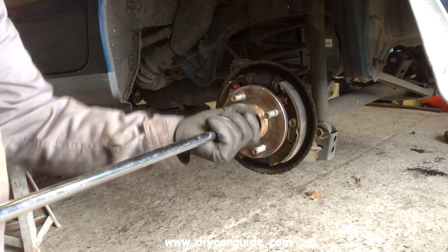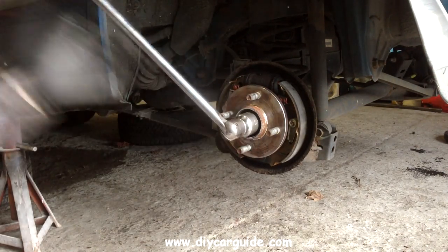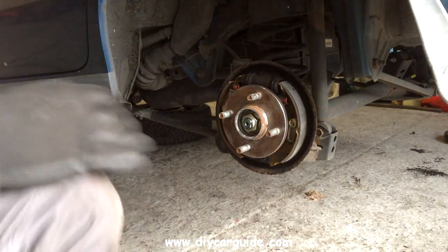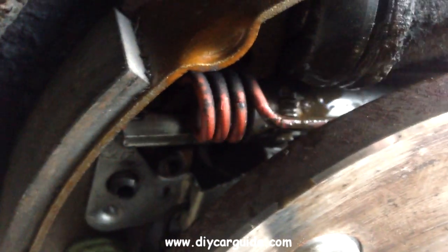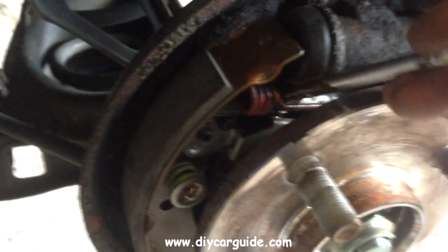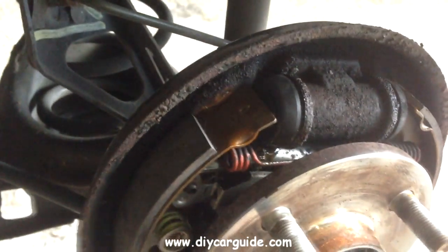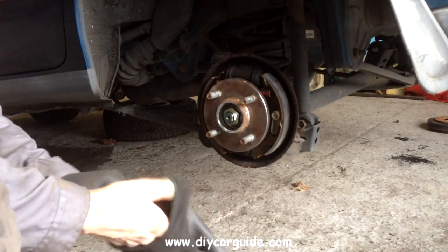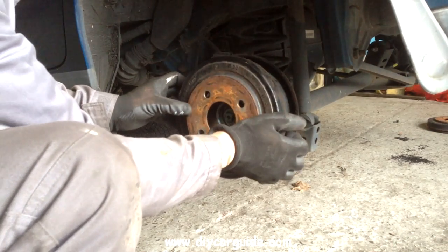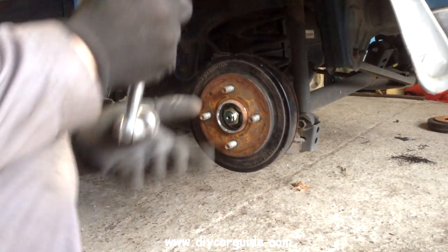Once I've put the hub nut on, I'll be adjusting the brakes. The trick here is to fit the drum, and if it's too loose, use the adjuster to move the shoes out so that they lightly tip the drum — this just needs a couple of clicks out. You can see me adjusting it out and see the clip the way it operates — it stops the adjuster from winding back the wrong way. Time to see if the drum fits nicely — and that's just nice. It should just lightly rub the shoes without binding or stopping.